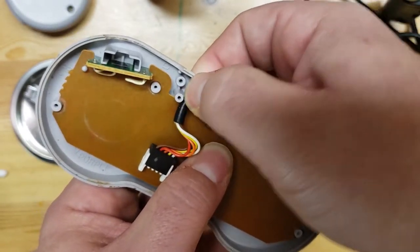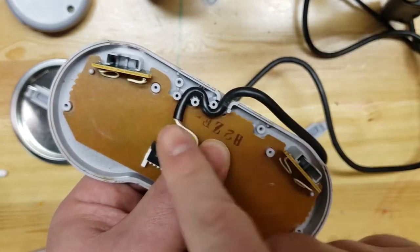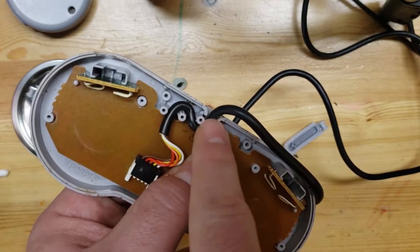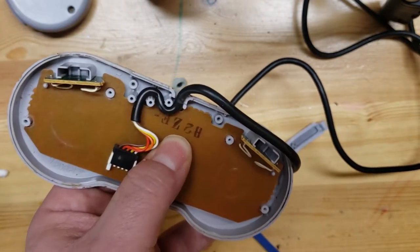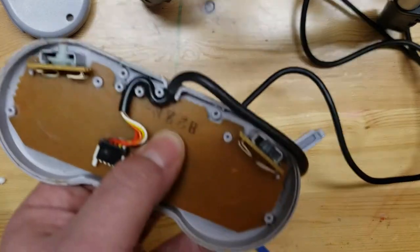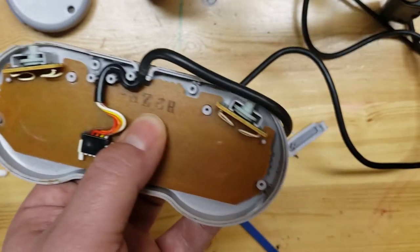Once the PCB falls into place, hold it from the center, make sure the PCB boards are seated, then put the back on and press it in. The cable goes around and in between these two posts here - that's to prevent tension. If you go to yank on it, the tension goes to the posts, not on your plug, which would rip it off the PCB. Then we can slide the L and R buttons in.